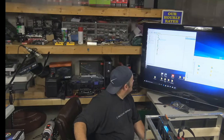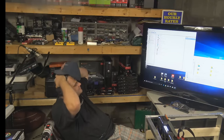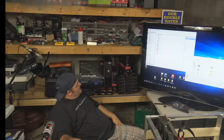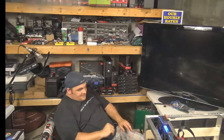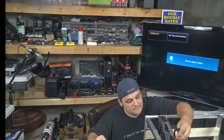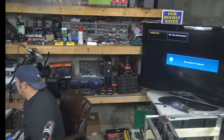It is. So let's uninstall it again. Let's scan for hardware. Let's see if it fixes itself. It fixed itself for a second. Went right back to code 43. Yeah, I think that's kind of just telling it that it's not liking it. So myth busted on that one. It needs both. There, I'm gonna pull that out because I'm not gonna keep that in this one. So no, not with Windows, it doesn't work.